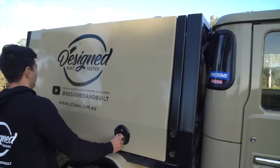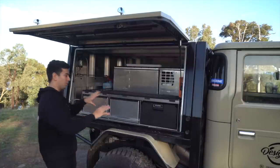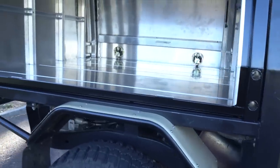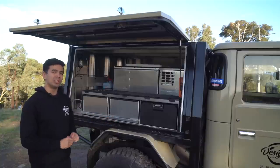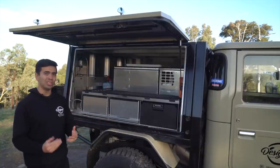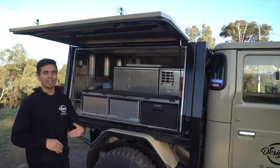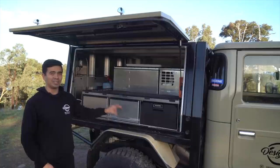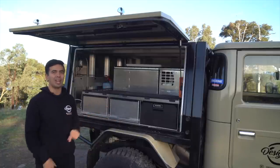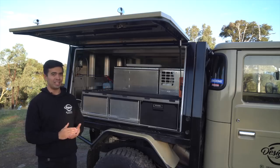Now onto the outside of the canopy. One of the design features is that the door seals are integrated into the door, as opposed to on the canopy. This allows for a completely flat floor — you don't have to put that 50mm return on that you see in most canopies on the market. That makes it a lot more challenging to mount things like drawers, and generally you'd have to put a false floor in, which adds weight and wastes space. Also, if seals are mounted on the canopy, there's more likelihood of damaging them when loading. Having the seals on the door solves both issues with no downside.